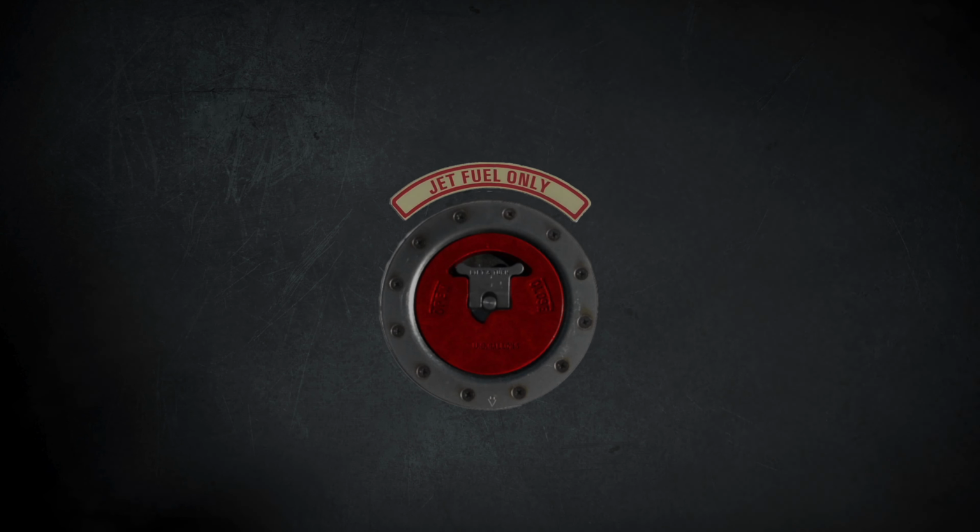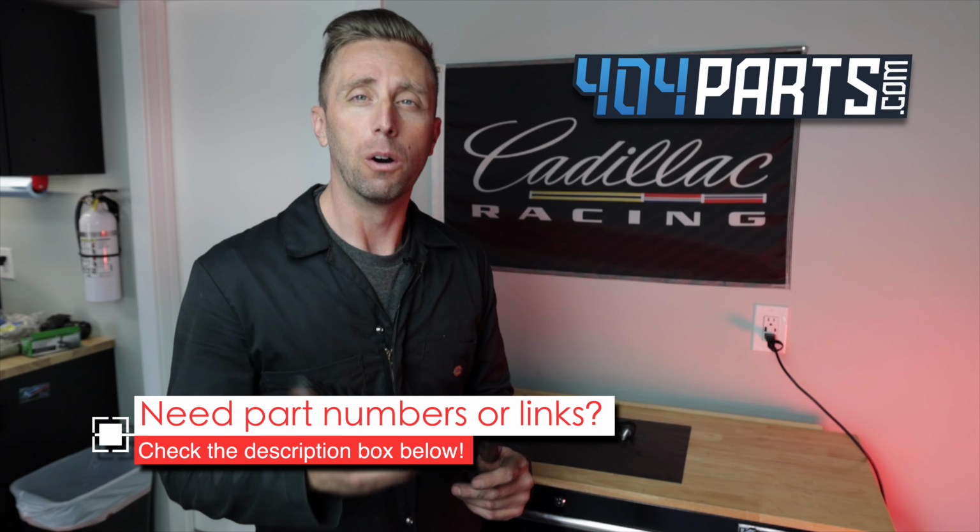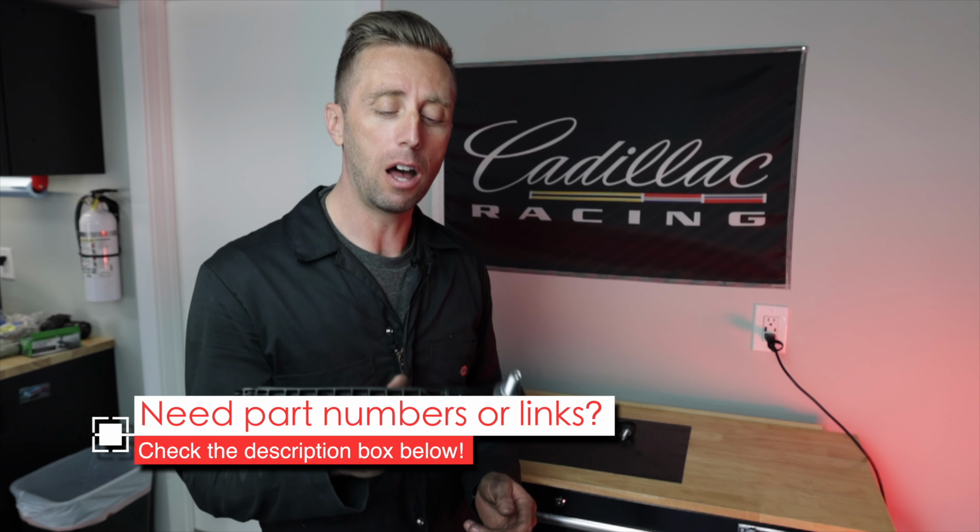So these are called the sway bar end links, or sometimes called drop links. Oftentimes they're made of metal, but the ones on the CTS are plastic. You can get replacement ones from places like 404parts.com or even Rock Auto. Rock Auto sells the Moog ones that are metal. It's an aftermarket suspension part. I have heard that some people weren't so happy with how those went, but you know, results may vary. I'm sticking with OEM for this car.